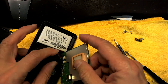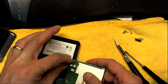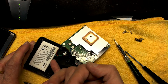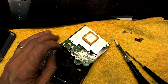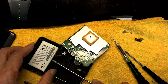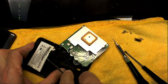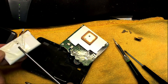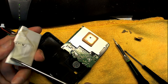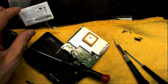At the bottom there are two cables — one is for the speaker and the other is for the battery. Pull out the one for the battery. The battery is glued in with double-sided tape, so you have to use a flat screwdriver, slide it inside, and pull it up. It's very sticky — it even sticks to the screwdriver. Once you pull the battery out, set it aside and get the new battery.